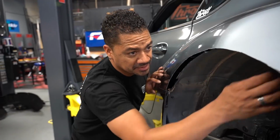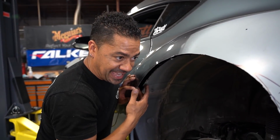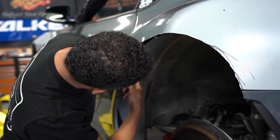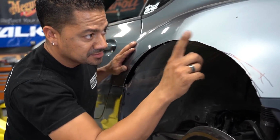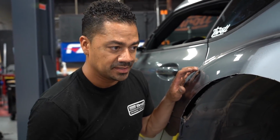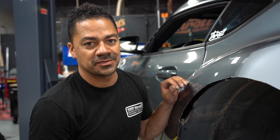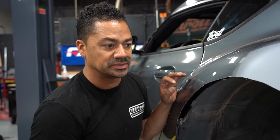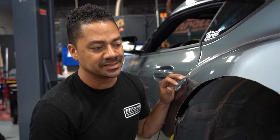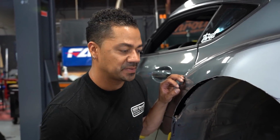Now I make the first cut. Look at that. I'm gonna have to make a metal plate to cover the excessive gap between the panel and the wheel well. I think I'm gonna keep going. I'm gonna cut out here. Then come in. And then this needs to be trimmed even higher. It's really hard to get this whole thing into one piece of metal to be perfect, because every angle needs to be perfect. If it's not perfect, then the metal wheel well will not fit correctly, and it takes time. It's a lot of measuring, a lot of cutting, a lot of trimming until you get it right. And then you have to weld it, and you have to pray that the heat from the weld doesn't bend it and warp it, and then you're back to square one.